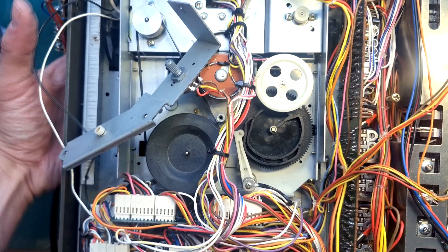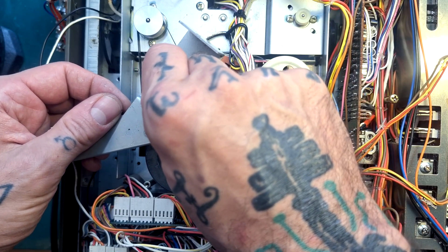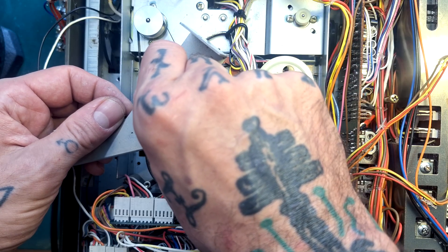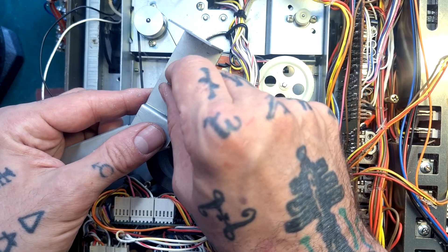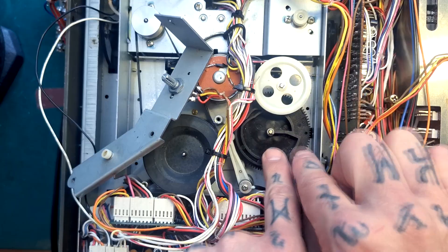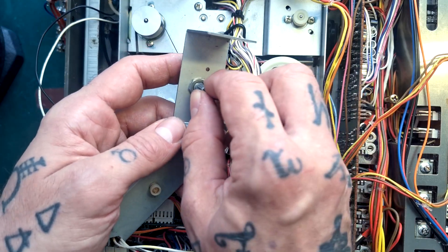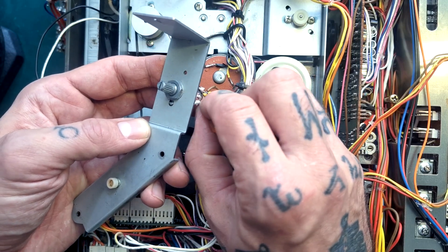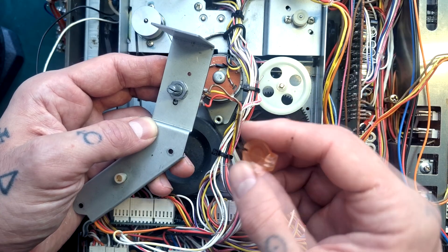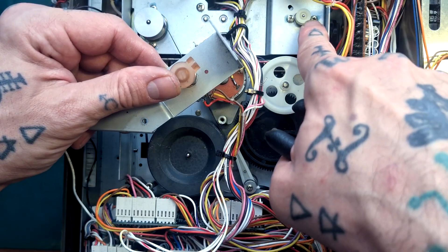Everything is plugged in electrically except the record and playback head, which is unnecessary for this, and I haven't bothered screwing it into the chassis. I reach under and turn it on. At a certain point in the middle — you can probably hear it — it comes to a stop. Too far one way it buzzes, too far the other it buzzes, but there's a sweet spot in the middle where it's almost a dead standstill. I've got it to stop there, which should correspond roughly to where the lowest point in head travel is. Then there's a bad solder connection — one of the risks of putting strain on these wires — I'll resolder that in a minute.